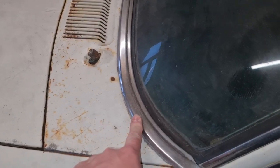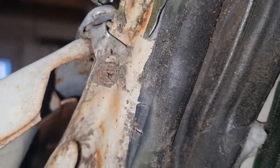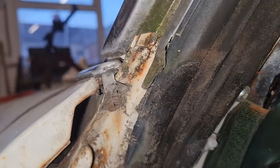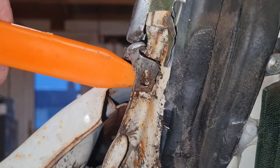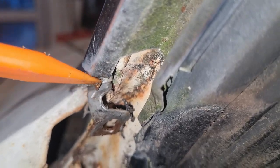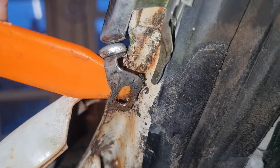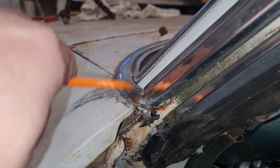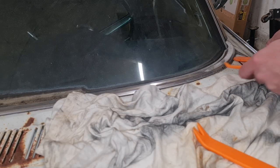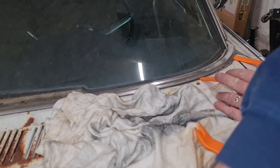Next, you've got to take off this trim. To start with, what we've got to do is go inside the door shut and take out that little screw there. Because you've got a little piece of trim here that holds this end down, so you've got to take that off first, both sides. That's the screw out. This bit of trim clip runs parallel — you can see that bit there on top goes in to that piece and holds that end down. If it doesn't come out it doesn't matter, because it will come out with the actual piece of trim. I've got some plastic trim bit removers so as not to damage too much on the paintwork. It looks like we've got a trim clip here, so I've got my pliers.